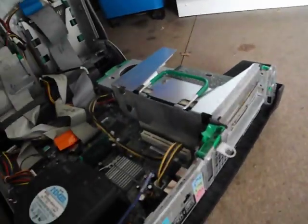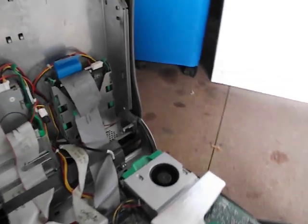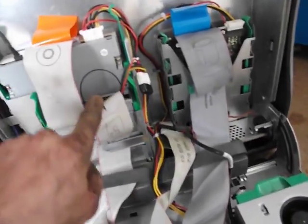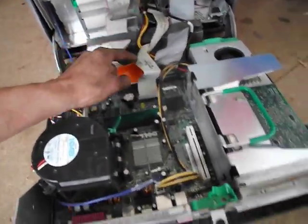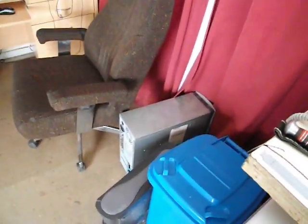It's got a 2.46 GHz CPU in it. There's not really enough space for another hard drive and it's only IDE. If I removed the CD-ROM drive I could put another hard drive in that spot. To use this for CCTV purposes you'd really need an external hard drive, and I'm not buying one of those. So I'm not sure what the point of getting this was, but like I said, mostly for YouTube. There's another one here which I'll do a separate video on — it's a Hyundai case with some no-brand motherboard in it. It's a piece of shit as well, but oh well. See you next time. Bye.